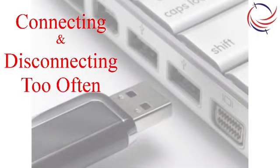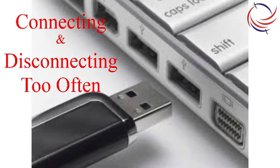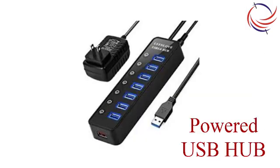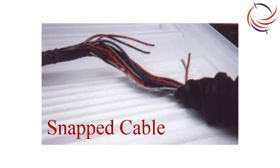At number four is reconnecting the USB port too often. If you are using a common computer for RVG and other uses, it is very likely that you may connect and disconnect the USB port of the sensor often. Remedy: buy a powered USB hub — you can connect and disconnect that whenever required rather than the sensor. It will prove to be a small price to avoid a big problem.